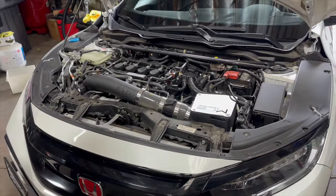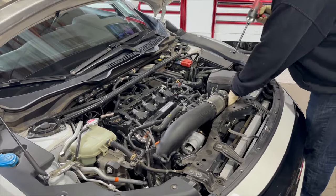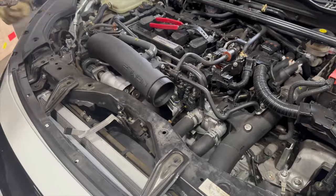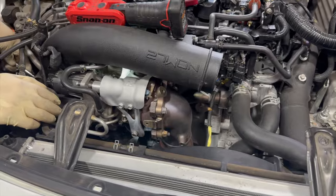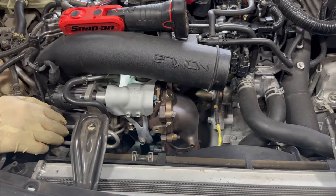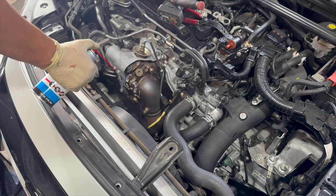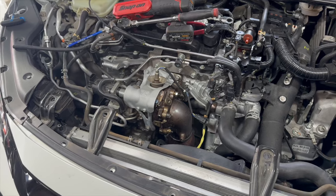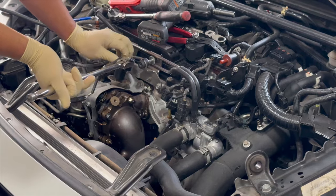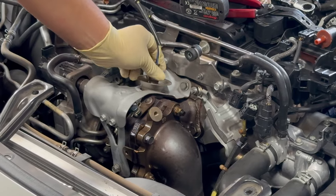Taking out the turbo isn't really that hard to do. You need to take out the intake, you need to take out the turbo inlet piping — we undo the one that holds the latch down just to give us a little bit more room to work with the inlet piping, only because it is tough to get out from the small space you have. Afterwards, you're pretty much working on the downpipe. From there, you're just taking off the O2 sensor, the heat shield, any miscellaneous part that's connected to the turbo from the downpipe. And sure enough, the turbo comes out.